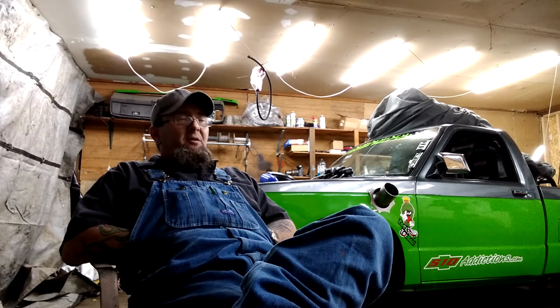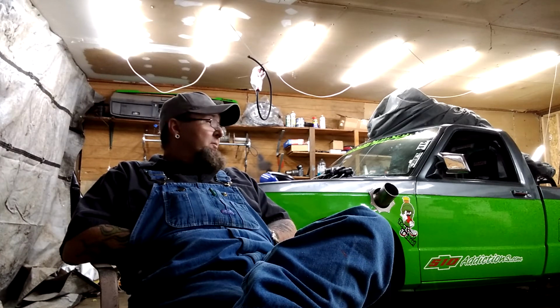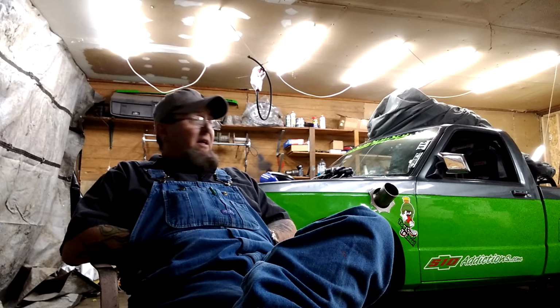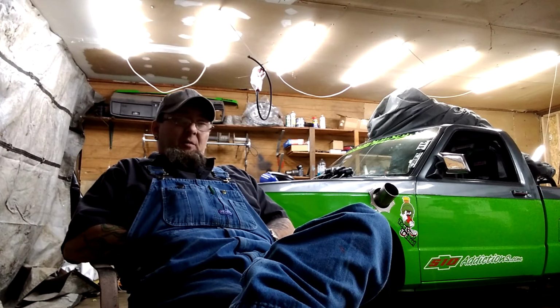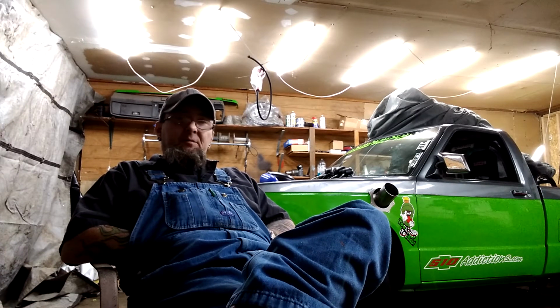The little deal where we had trouble with interference with the alternator and everything, I just took some scrap 3-inch exhaust pipe and some V-bands and made, I think they're 30 to 35 degrees, to kick the turbos out away from the motor. Worked perfect. You've seen the other videos, they fit in there nice.